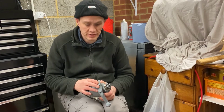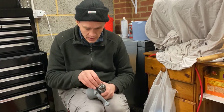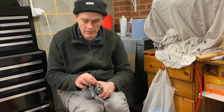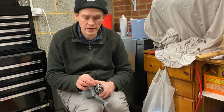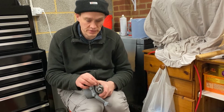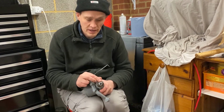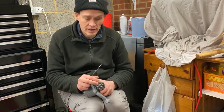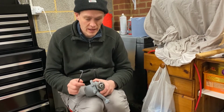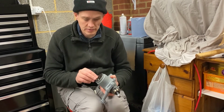If you're doing your swivel joints yourself, it's always a good idea, when you've got it all stripped out, to take the grease nipple out, obviously you've got to do that to get the lock tab off, and dig out the hole of any dried up or hard grease. Blow the hole out with an airline, or pump grease through with the grease nipple, or failing that, use an engineer's scribe and dig all the hard grease out. Check the hub threads for cracks and the seat inside, and then just rebuild up from there, keeping it all clean, with the hub bearings and hub seals in here.